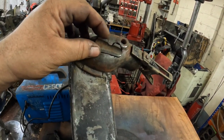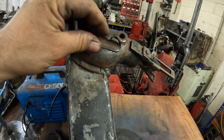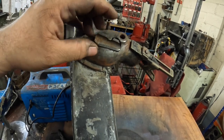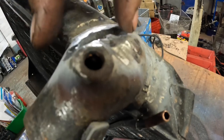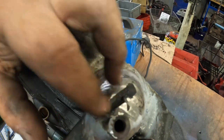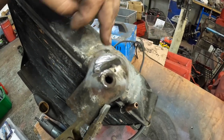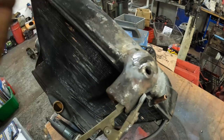I've chopped the bit of cast roughly to the right size — it sticks out here and there but that's exactly what I want so I can shape it to the right size. I'm going to cast weld it just in a couple of places to then start to shape it. Me and Graves have just put some water in it and it's got a tiny little pinhole leak there, and it's leaking from this joint just here. So I'm going to put a bit more weld in there. These are cast iron welding rods that I'm using — it's a lump of cast iron and I've heated it up as well. We'll get these bits filled and then water test it again.